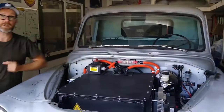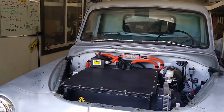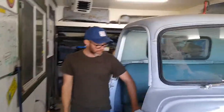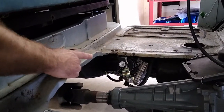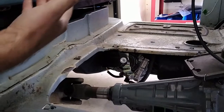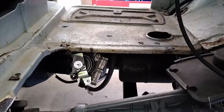That brake system is off a 1993 Ford Ranger — brand spanking new master cylinder, but the original brake booster from a donor truck. Because there's no engine, we can't make any vacuum, so we have to create it, and that's where this little unit comes in — a vacuum compressor off a 2012 Ford F-150. It runs into a switch, and once it registers enough vacuum to run the brakes, the switch turns the pump off so it doesn't run continuously. That little cylinder down there is a vacuum reservoir, giving some residual vacuum for a constant supply to the power brakes.